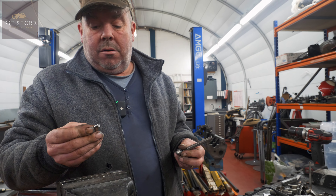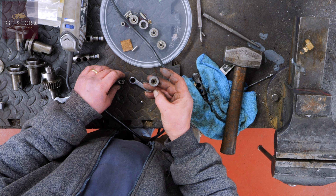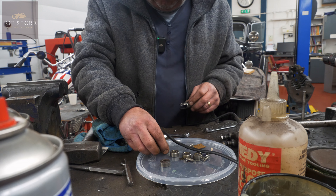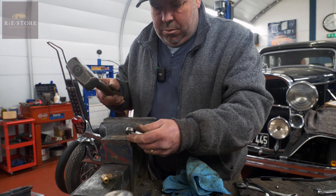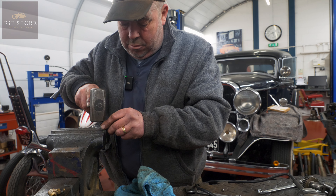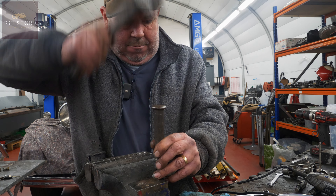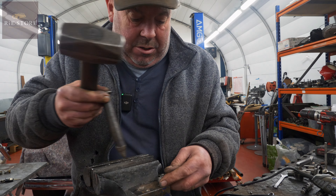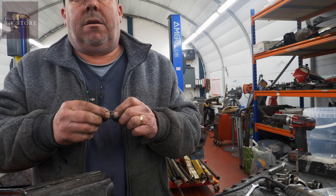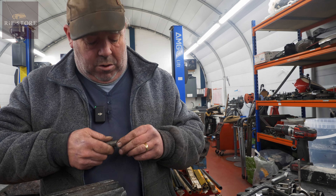How or why would it have been smudged over? Well, that's Harley factory - that's been there since 1943 or whatever. They've just been on a big long production line, got a big pneumatic press, and it's gone. That's the old style - there's actually no needle rollers in them, they're just metal on metal, so that's always going to wear out. New roller, new pin. Tap it through a little bit more. Now you can give it a good wallop on your hard block. So that's smudged him - turn him over. And that's it. It is meant to be smudged over to keep it in, but obviously they do it a lot more from factory.